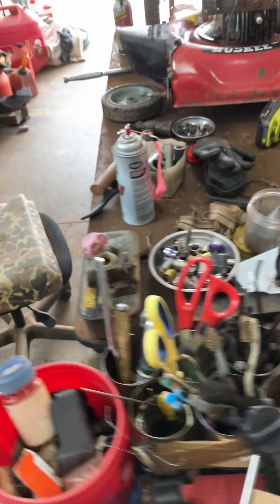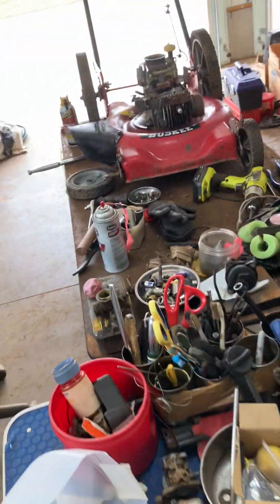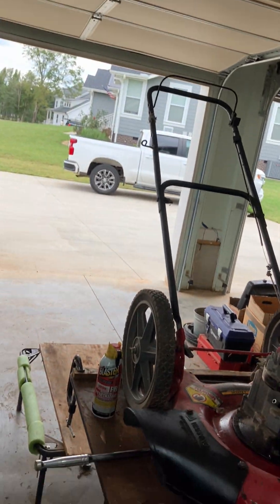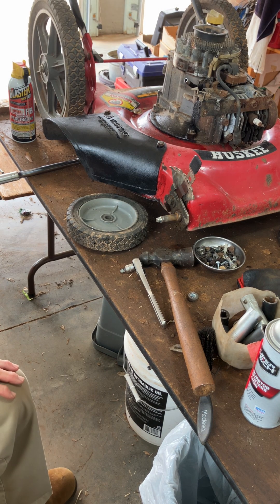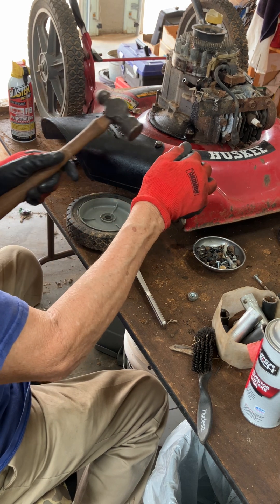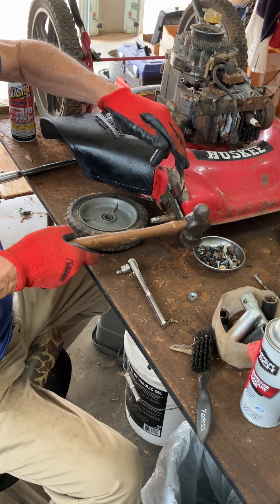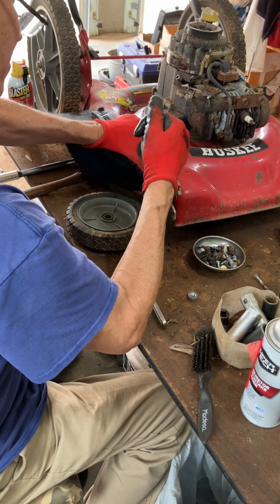Let's go around this way and see if we can pound on this thing and get it free. I'm going to have to set the phone down in the holster. Now you can see the wheel. The PB Blaster has been on there for a minute or two, and this thing wouldn't budge earlier. You never want to bang on this part because you'll ruin the spring action — so I'm going to clear this and hit here. You can see that's moved at least one adjustment, and it's starting to free up now.